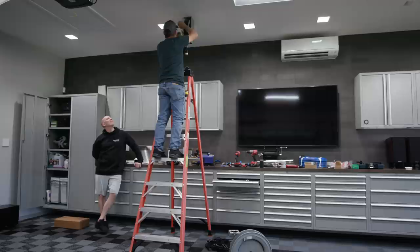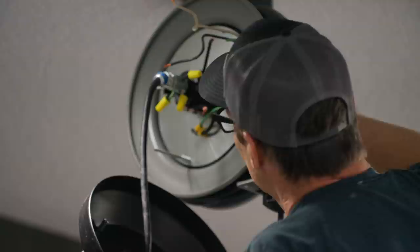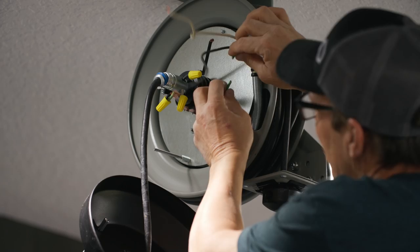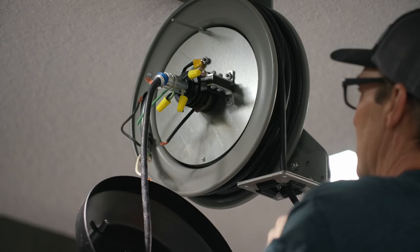On each side you have an anti-vibration clamp. And what I do, rather than having to redo all these ring terminals, because this is ring terminal to this and you'd have to put another ring terminal, I just cut the ground here. And then I wire nut the new ground to this ground. Got it. And you can see how that spins around. If you had these wire nuts out in the breeze, they would catch these, on the side.